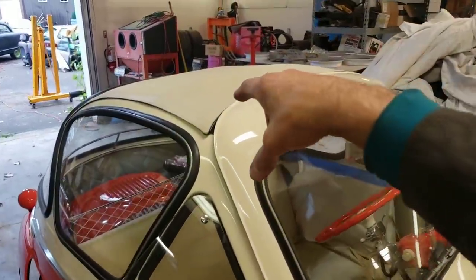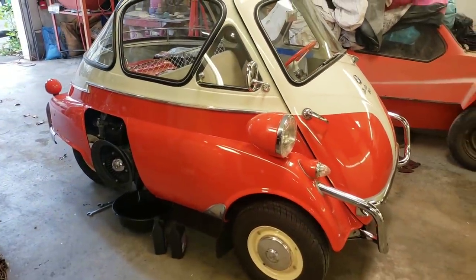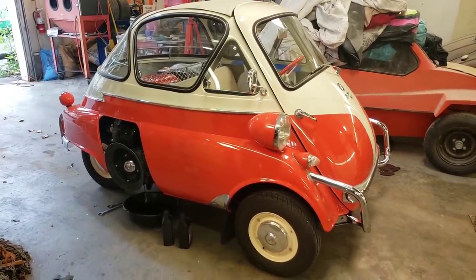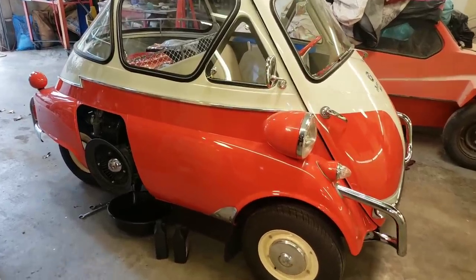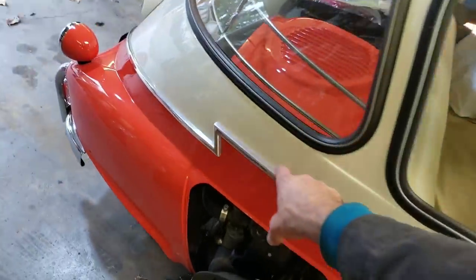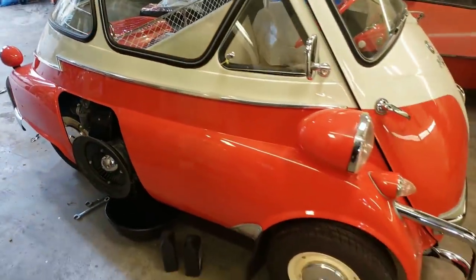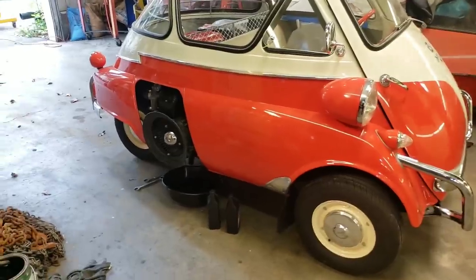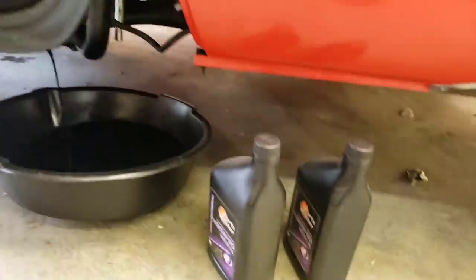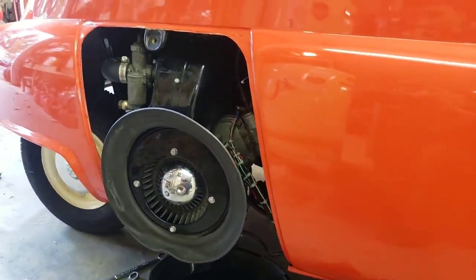You do have the top which you can open and these side windows, but I like driving sliding windows — that's just a personal opinion on my part. I think these look great but I wouldn't want to own one. This one is extra special because it has — I believe it's stainless, maybe aluminum — Z trim that's continuous around the car and it's two-tone paint. It's a beautiful car. I'm changing the oil right now, it takes 20W50, it's air-cooled — just two quarts — and once I get the oil in there we'll start it up and take it for a drive.